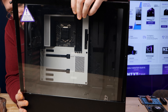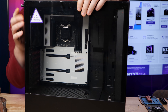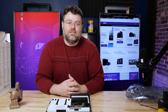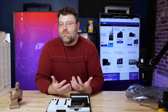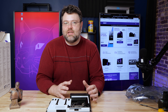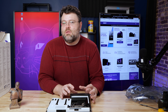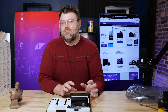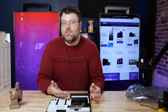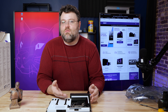In terms of power input, this motherboard is pretty good. However, I pushed a 10900K to the absolute maximum and was getting VRM dropouts around 5.3 GHz. Repeating testing with an Intel 10850K, there were basically no problems at 5.0–5.1 GHz across the board with some added active cooling and tweaked settings. The VRM implementation is probably the weakest point for maximum extreme overclocking. For a reasonable system with a reasonable cooling solution — not spending more than $300 on CPU cooling — the VRMs will be fine.